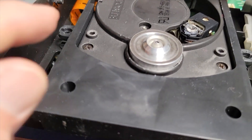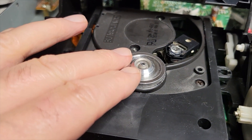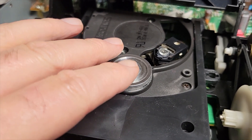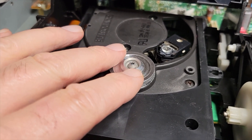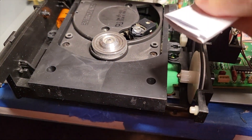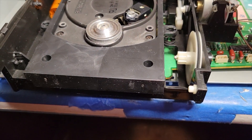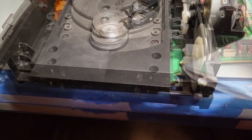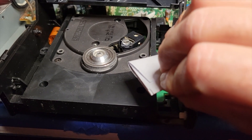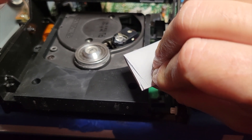This is going to really suck trying to get this platter off. I'm not even sure it's going to be possible. I don't know if it's glued or just pressed on — and then to get it back on at the right height. In order to make sure I had the right height, I folded up these pieces of paper and shoved them under there to make sure that was a thickness that could just barely fit. So that'll be my shim against which I can maybe press the platter back on to the right height when the time comes.